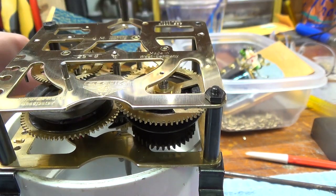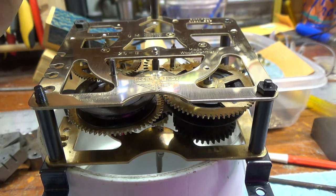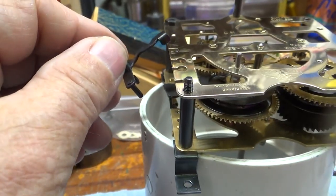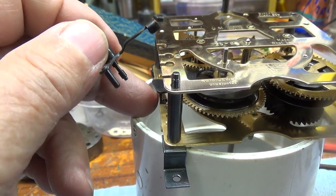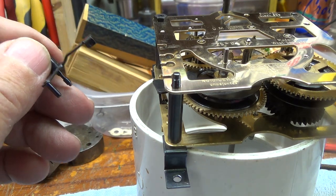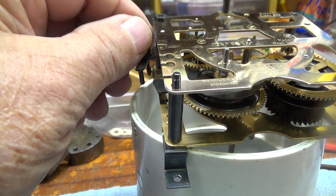The only thing we have to remember now is to get the little door opener in there, and it's going to go in like so. This pin is down so that it can be caught by that hook. You make sure the flag is in. And this has got to go above the second wheel so those little paddles can catch a hold of it and lift it. Let me make sure those are looks pretty good. Okay, so we're going to put that in here.